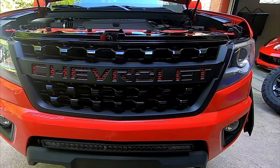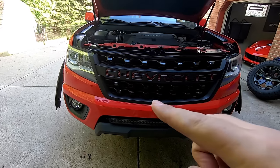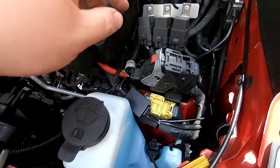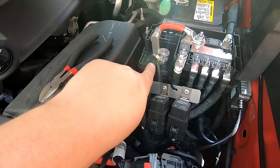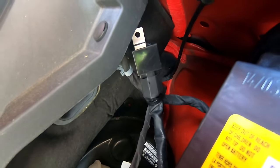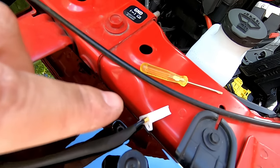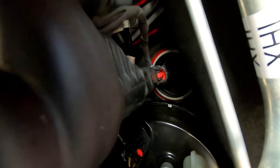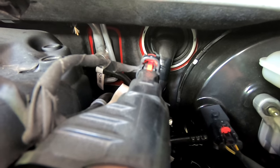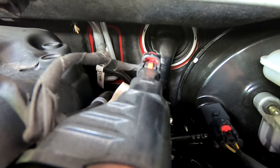There it is, guys. What do you think? That light bar gives it such an aggressive look. I got everything lined up, everything is ready to go. I just got to bolt everything in, and then we're going to move on to the wiring of the light bar. When running the wire, it comes up right through here. I connected the positive right here, negative obviously right there. I mounted the relay harness right there, just zip-tied it to existing wiring. This part that has to run into the cabin, I'm actually going to put it right back through there. There's actually a little indent in the rubber — if you push something metal through it, it will puncture through to the inside of the truck pretty easily.